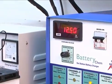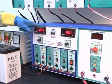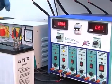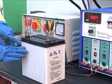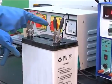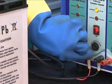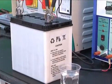During charging, keep your eyes on the volt and ampere meter of the charger. If you notice that the voltage and ampere of the battery are developing then you are proceeding in the right direction. If there is no development in the voltage and ampere, then you might have forgotten to check the water level, one cell of the battery may be shorted which you missed, or there may be a loose connection.